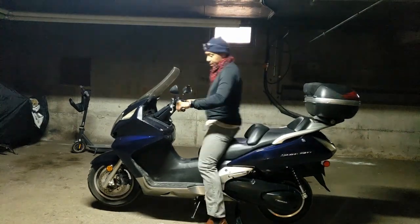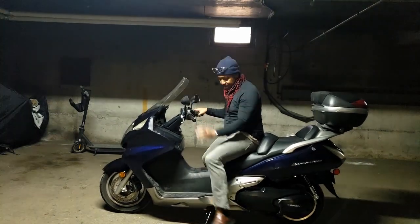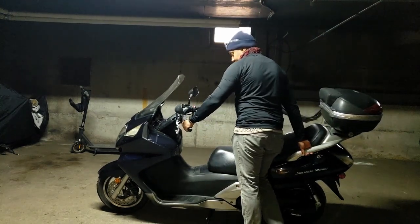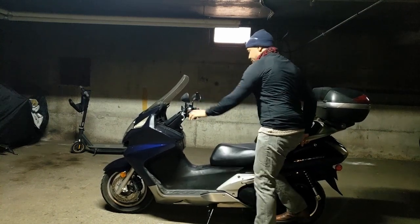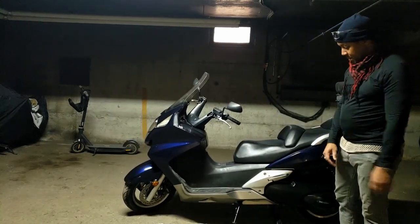well, pull up to the spot, take out the side stand, drop it on the side stand, get off the bike. Grab the left handle and grab wheel, put it up on the center stand, make sure that it's balanced. Rock it, pull, and it's up on the stand.